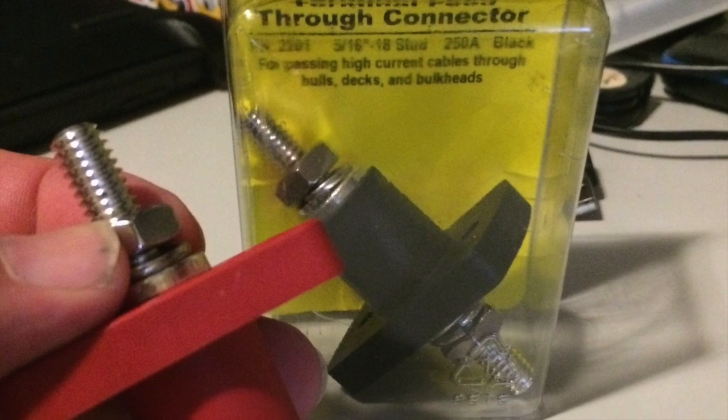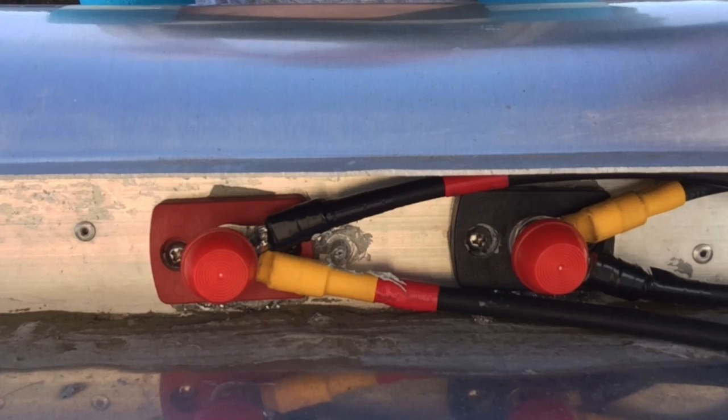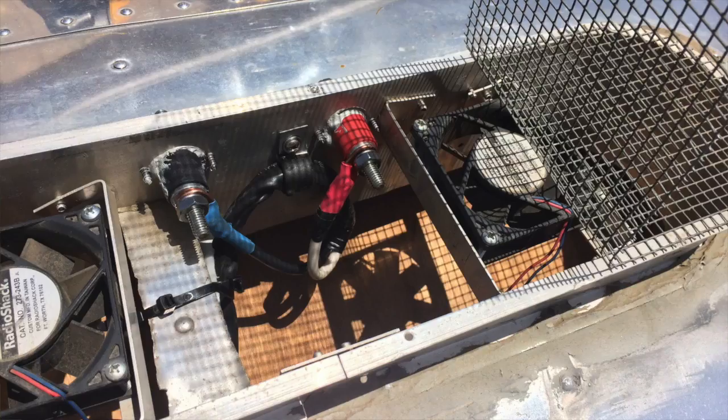The wiring from the panels on the roof comes down through the refrigerator vent. I used Blue Sea bulkhead terminals that allowed me to drill holes through the side of the vent and put in these bulkhead terminals to create a connection point at the roof — a junction box of sorts. That allowed the two panels in the back, paralleled together with the MC4 bridging clips from Go Power, and the front two with bridging clips, to bring two wires to the terminal block. From there, the other side of the bulkhead terminals — I ran a number six wire down the refrigerator vent into the trailer and up to the charge controller.